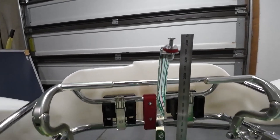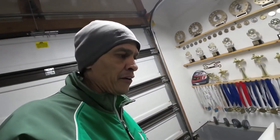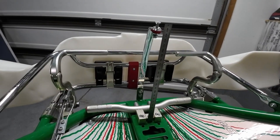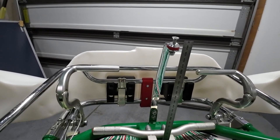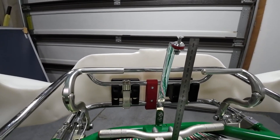It looks like the caster is pretty even across both sides of the go-kart. Really the only reason I would check caster like that is if, say, my son gets into an on-track incident and we think the front of the go-kart might have a bend in it. It's a real simple check: just mount the ruler, turn the wheel one way, wait for the laser to come across and remember the number, then turn it the other way — and that's how you verify you've got even caster across both sides. Thanks for watching and have a good time at the track.